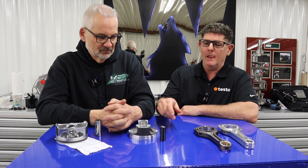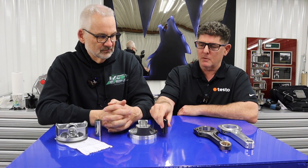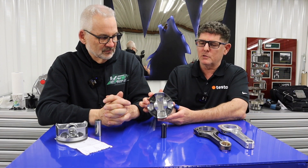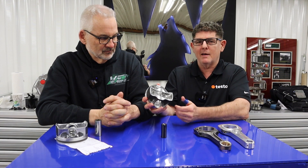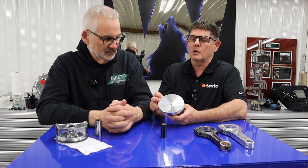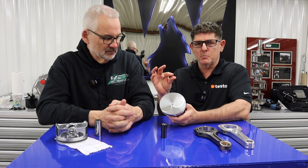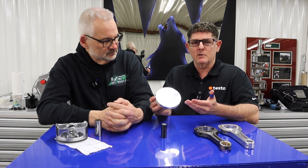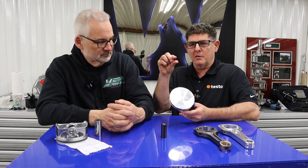You can change things out over time. This is a much smaller pin and a lighter pin, but it does have a robust wall thickness that helps make up for that. The back of this piston has an architecture to it, so even though it's a smaller, lighter piston, it does have strength. I'm assuming that you've moved the upper ring land up. Brian mentioned the smaller thickness of the rings, which reduces drag in the engine — the thinner they are, the less drag, but you still get ring seal because of the gas porting.